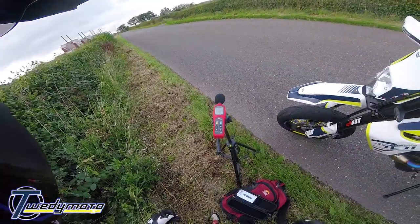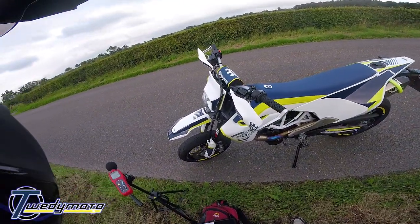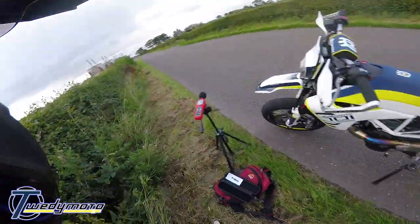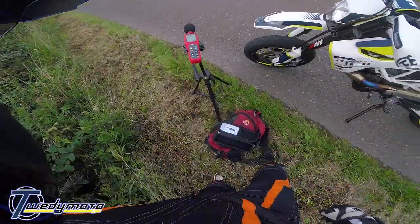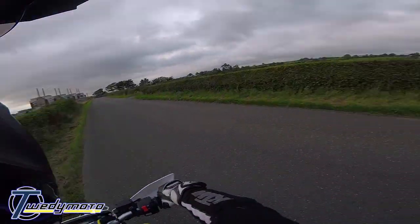So that's how loud it is doing a flyby as well — 112, 110-ish on static, and then 118 on the flyby. I'll have to take it to bits and change the core and the packing and stuff, and then retest. Let's crack on.